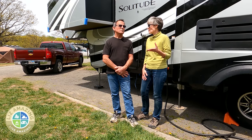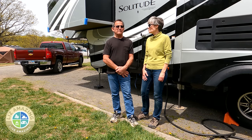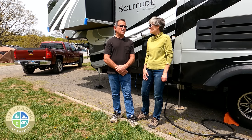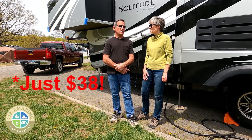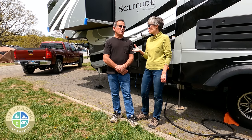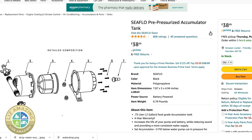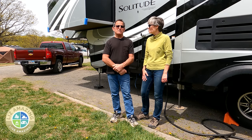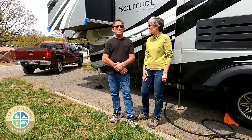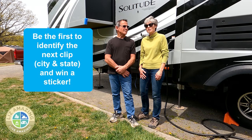The accumulator gives you a steady stream more like what you have in your house. It's one of the easiest modifications I've made — you just put it in line between the outlet side of the pump and the inlet side. You really want this no matter what kind of camping you do; it makes a noticeable difference on water pressure. The accumulator we bought was under a hundred dollars with fittings — maybe a little over a hundred. It doesn't require much maintenance: you just install it, pump it up via the Schrader valve on top to the cutoff pressure of your pump, which is right under 40 PSI, and then you don't have to touch it. Remember, links to everything we talked about are in the description and at the Amazon store.